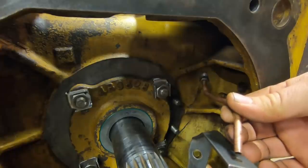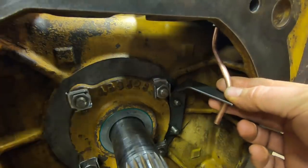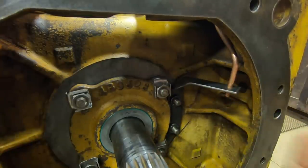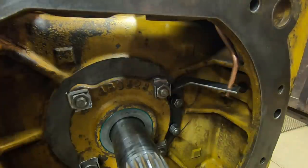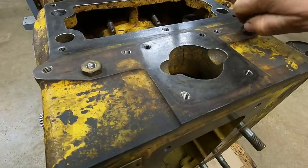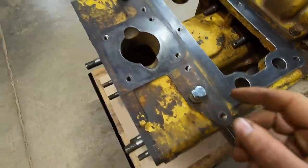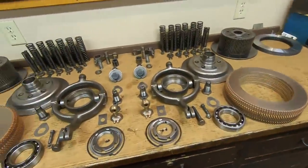Now the lines and the brackets. You'll find the easiest time by starting the line in the bracket, starting the bracket on the studs, and then going up and starting the line on that fitting. With the line only finger-tight so it can move a little bit, put the lock washers and nuts on the bracket. Then tighten the bracket, tighten the line, and repeat for the other side. To finish it off, the new oil caps go on the very top. Both oil caps are tightened in — we've got the oil delivery system in place, fully installed. That wasn't so bad.